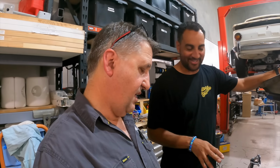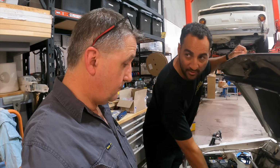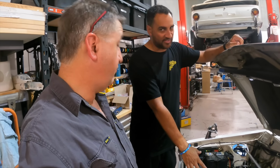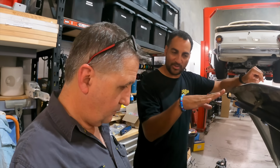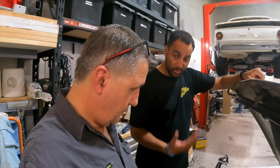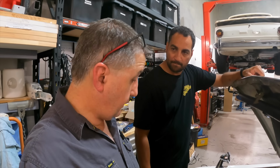That's not a today video. We'll leave it to the internet. We'll leave it to the comments, and discuss whether. But what you can't do is turn this fan off. True, because it is bolted to the engine. It hasn't even got a clutch on it. That fan just keeps spinning. So if we take it away, we can control it ourselves. Easy. It looks at the coolant temp sensor and then it goes up through a threshold, turns on, and then once it drops down below that, we can turn it back off again. But also, you can have an override on that little keypad as well, so you can turn that fan on whenever you want. That's cool.